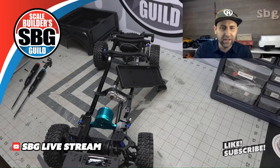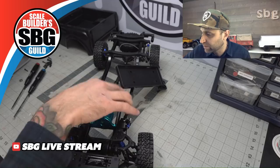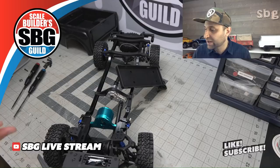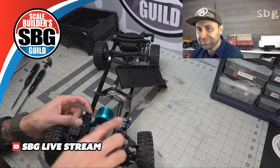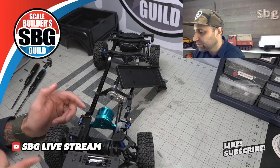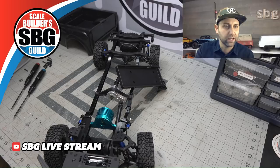Are the frame rails running the full length? They are a separate piece. It's almost like the IFS system is separate from the front rail. But that's good, because that means you could maybe even shorten this wheelbase just by pulling in that whole front section here. Right here is where they join up the two sections of rail. So in theory, you could take out one of these screws, move the whole thing back, and make another little mount or screw hole somewhere to make this shorter. That actually would be a really good idea. Thank you for asking that question, Humboldt.